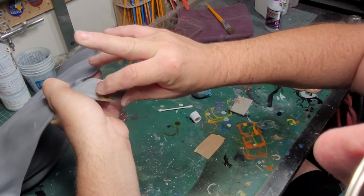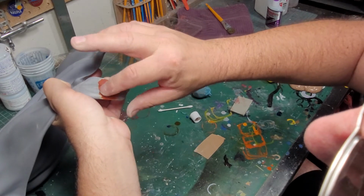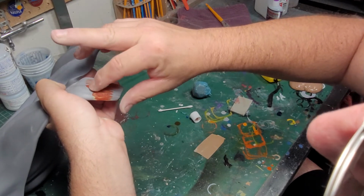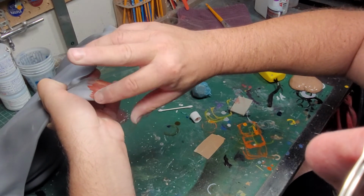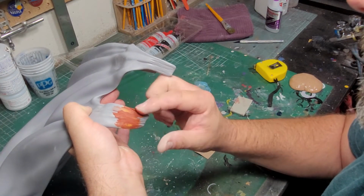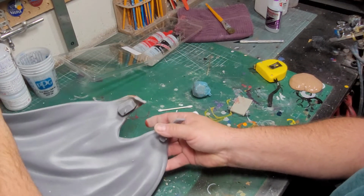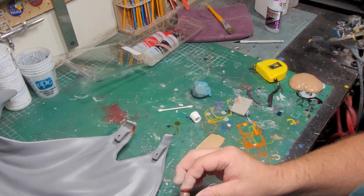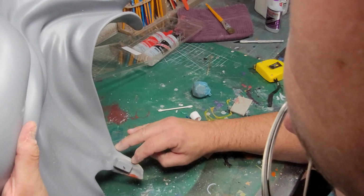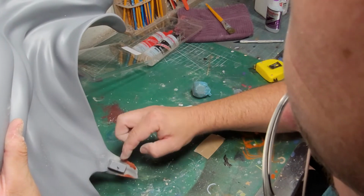And this is air dry stuff, so I've got one spot that's kind of deep, where it chipped out a little bit, so I'll probably have to do this 2 or 3 times. So it's a little slower process as far as drying goes, but I don't want to stick straight up body fill on here. It's a little aggressive for this small repair. So I'll probably have to let this sit for 30-40 minutes just to be sure that it's dried, and then I'll do it a second time, hopefully after I prime it.